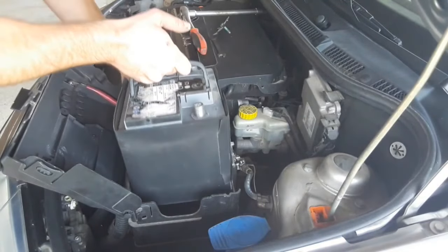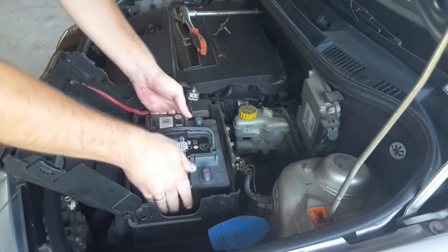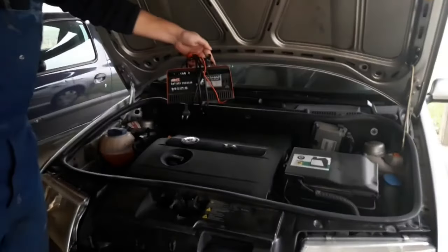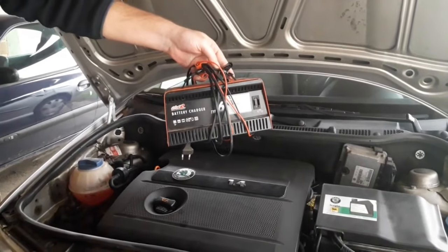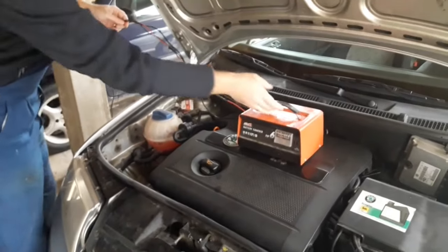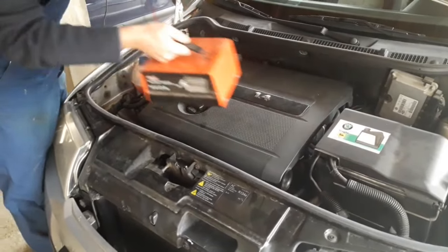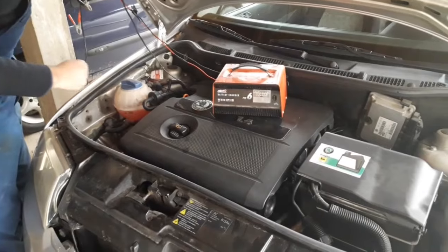If you want to see how to replace the car battery, click on the link to see a separate video dedicated to this topic. First, properly position the charger under the engine bay. Know that you are putting an electric transformer under voltage inside your engine bay — if you place it somewhere where it can fall off, you can damage the charger or cause an accidental short circuit. Position the battery charger, if possible, on a stable, flat, preferably plastic surface. For instance, the engine cover, like in this example, is a good place.